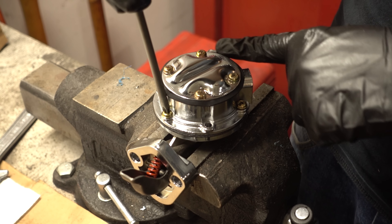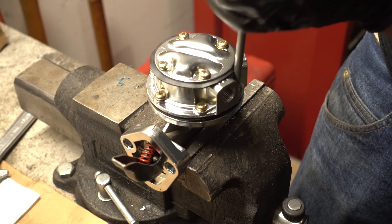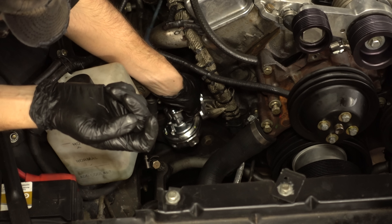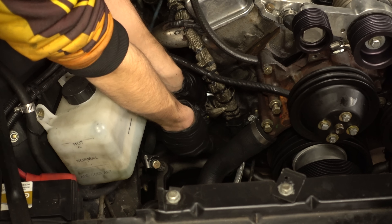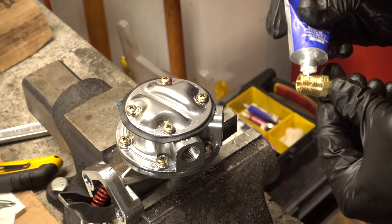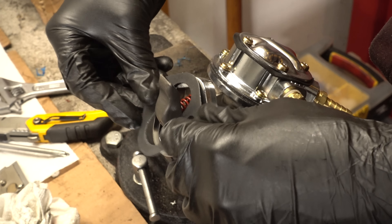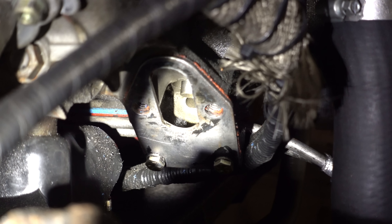The inlet on the fuel pump ended up too close to the frame, so I needed to take out the main body screws and rotate the whole thing 60 degrees. I rotated the outlet one whole step over so that when installed they will clear the frame rail. They're not necessarily in an ideal spot because this will still pass pretty close to the radiator hose, but that's not too big a deal. Let's install the barb fittings with some thread sealer and then bolt it in there — I've got these nice shiny new fittings. We'll clean up these mounting surfaces real well and use the gasket it came with. You can see the fuel pump push rod suspended by that bolt inside the block — otherwise it would have dropped down and you'd have to fiddle with it while getting the pump in.